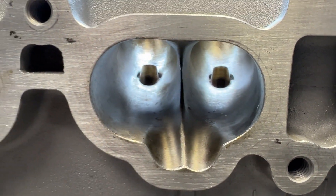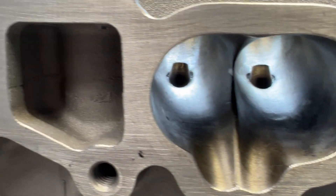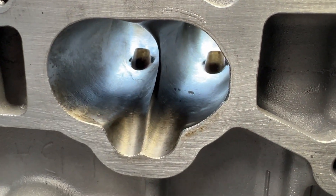Five years ago, we did our hand port — before there were CNC ports, we did everything by hand, and this is one of the examples. A lot of people think that a CNC port is better than a hand port, and that's actually far from reality. A CNC port is basically a hand port that got digitized — it probes the whole port and makes a map of it. But castings are not all the same, so not every head is going to be the same. By hand, if you're a very proficient hand porter, all your heads should be the same.